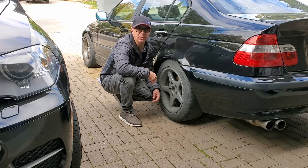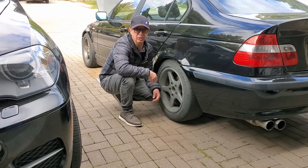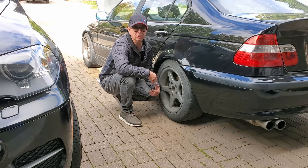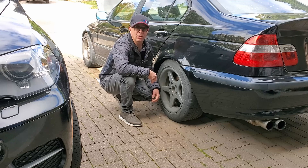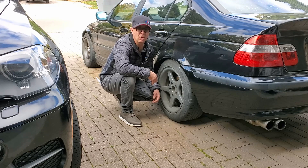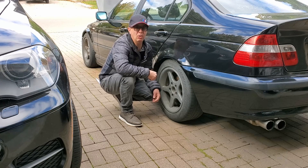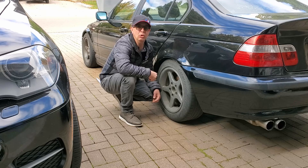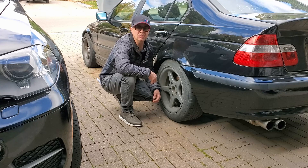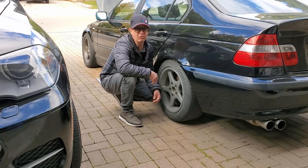I've now moved on to diagnosing why the car won't start. I started with tackling the electrical issues the car may be having. With that, I'll most likely be looking at fuses and relays, which could be a culprit for certain systems not firing up. Also in this video, I'm going to show you how to test a relay — whether it may or may not be causing an issue — and I'll walk through how to test any sort of 4- or 5-pin relay.